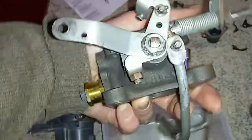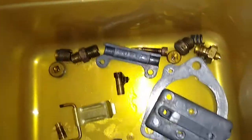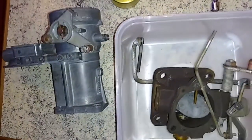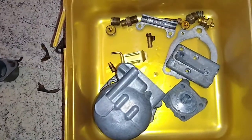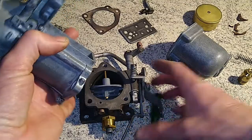For those who aren't interested, tune out now for your sanity's sake. The ultrasonic cleaner is quite good — stuff comes out quite shiny. We've got a bunch of jets and things in here, the float bowl all in bits, main jets and everything out. Because it's been in an ultrasonic cleaner with water and detergent I've rinsed it and blown it out with an air gun, and now I'm going to throw this in the oven at 100 degrees centigrade for about an hour just to dry out all the moisture before we put it back together.